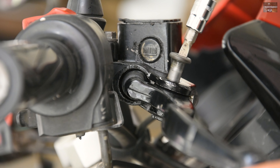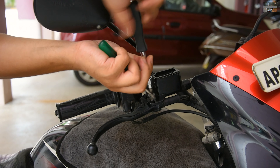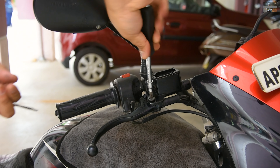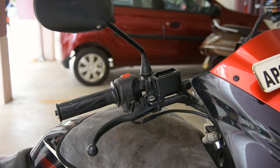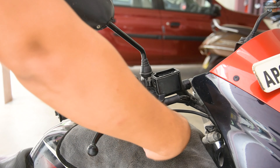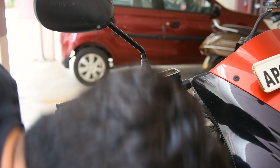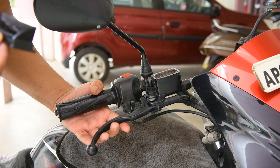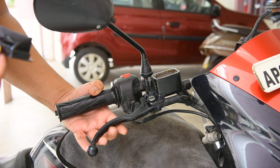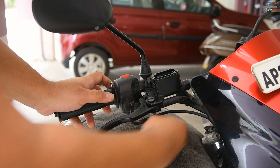Now I am installing the brake lever. This is the main bolt that holds the brake lever in place. There is a 10mm nut that needs to be tightened on the correct side. Once all these processes are complete, we will fill the DOT4 brake fluid and then we will start pumping the brake, because brake pumping is a very important step — it releases and removes any air bubbles that are present in the system. We have to make sure we pump the brakes properly.